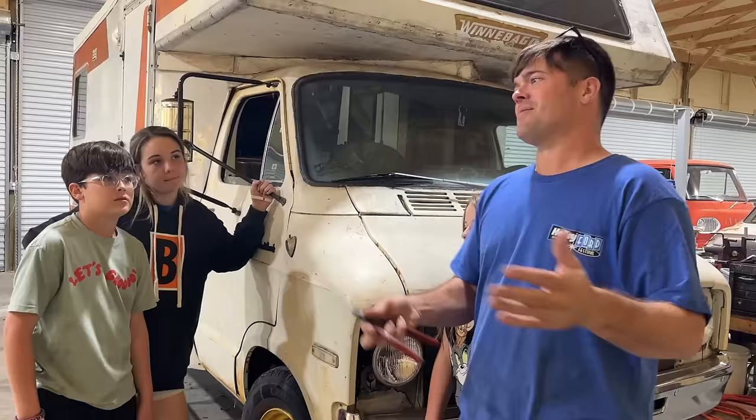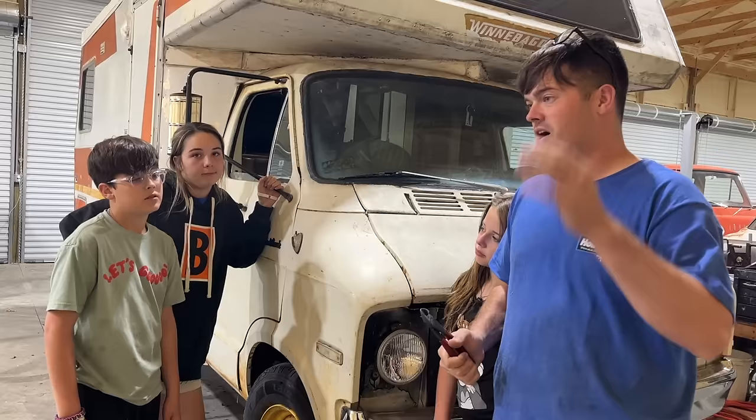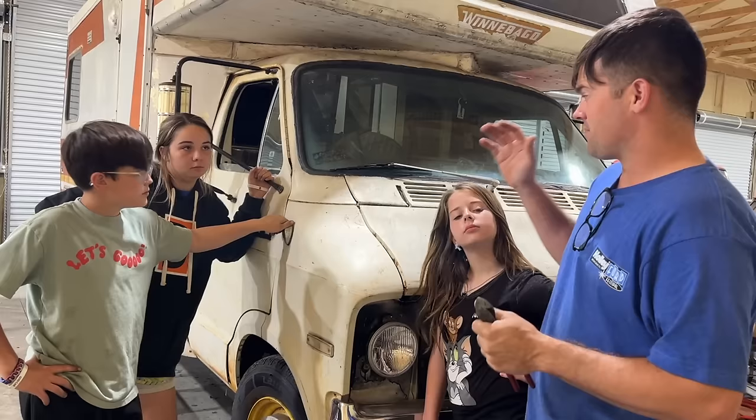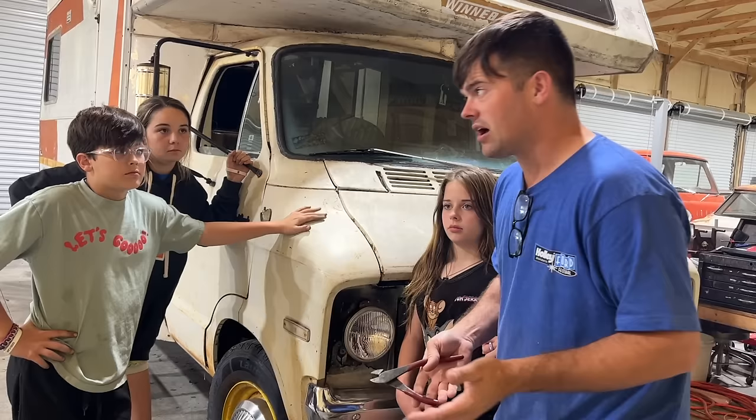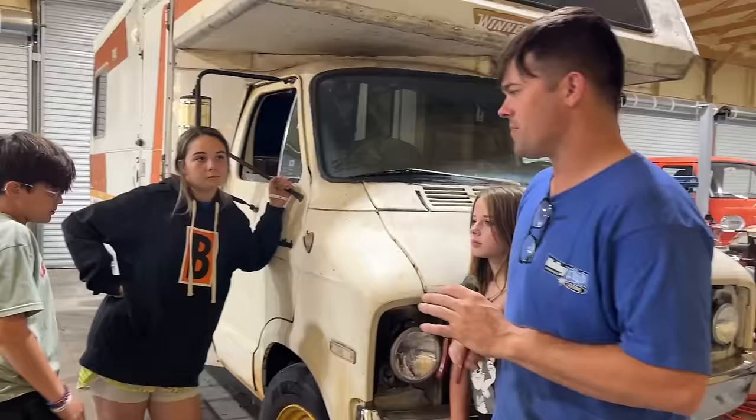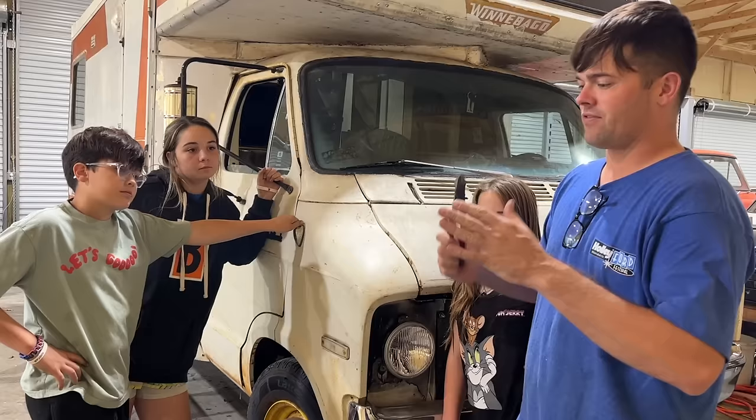If you've watched the whole series, then you know we had a lot of trouble with the factory Dodge computer. Best I can tell from watching other videos and researching, I started with the wrong computer and harness, which was a Dodge Durango. I've been told since then, you should really use just a Ram 1500 computer and harness. I might have had better luck, but I've also heard some bad things about those. So we're gonna bypass all that factory stuff, because anything stock like that has security features in it where if it thinks it's stolen or it thinks something's wrong, it'll shut you down.